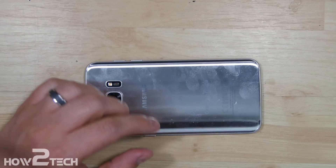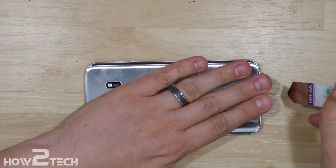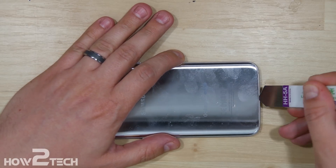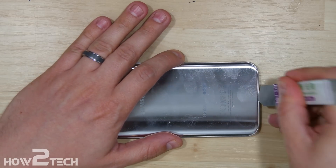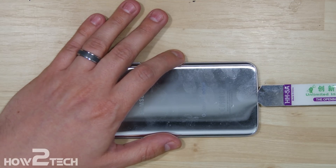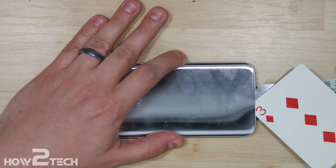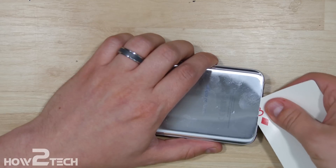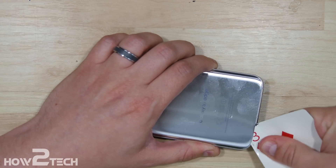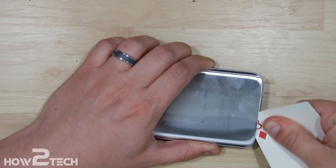It's feeling pretty warm at this point. I don't want to put my hand on it for very long, but it's not to the point where it's going to be melting anything. So we're going to take our iSesamo tool and just put the small tip in here. I don't want to use this metal tool all the way around because that will ding and damage the coloring on the back cover. So we're going to put our playing card in — this is a much safer tool to use. And you can see how gooey that glue is, it's already stuck to that playing card.